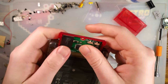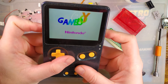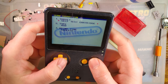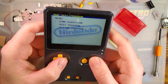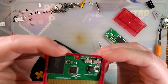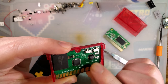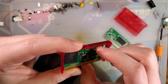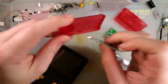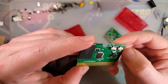I guess now is the part where we do a little bit of troubleshooting — that's what the GBX is for. Let me try wiping this save and I'll be right back, because I think this has a Minish Cap save on it despite the donor being Justice League. When I plug it in with the GBX, GBX can erase the save data and recognizes the chip. So the problem might have just been that I needed to erase it. Nope — 'EEPROM is not available.' Let me switch that to 64K. I still don't think that's it. I have absolutely no idea what it could be. It could just be a bad EEPROM chip — I will have to double check.